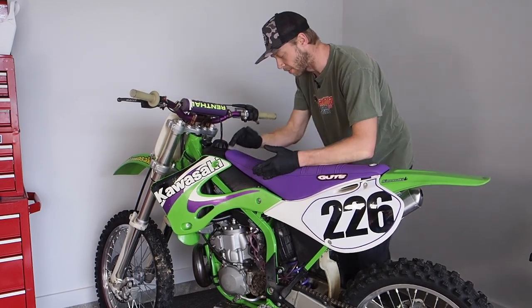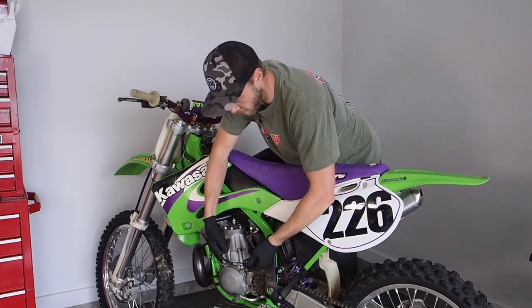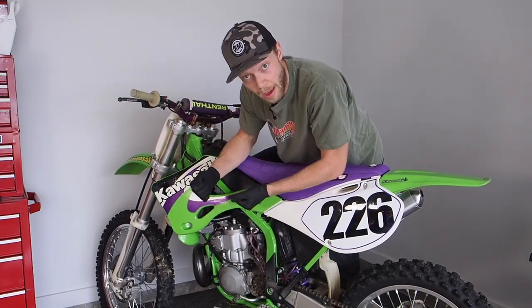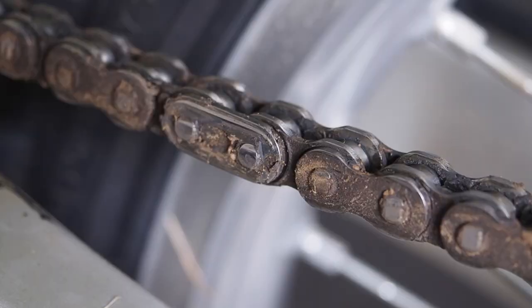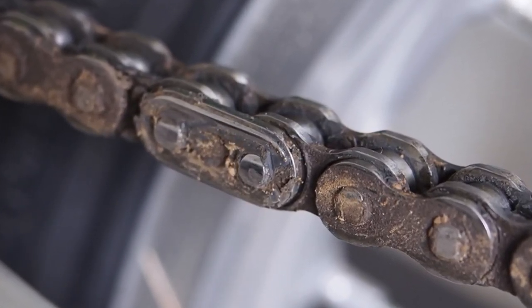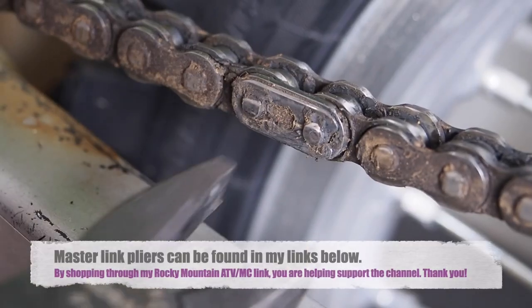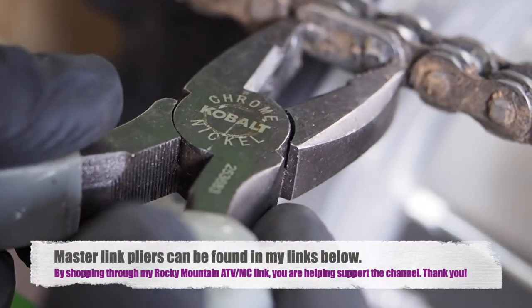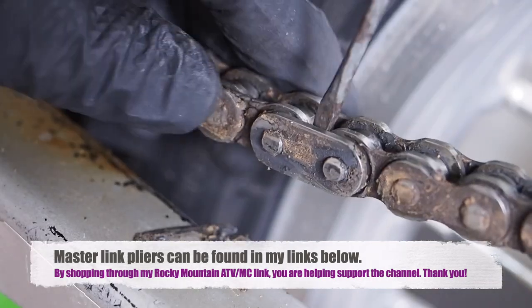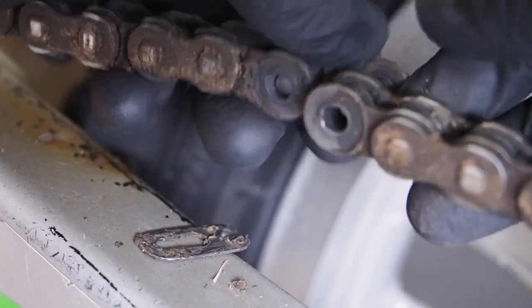If you're wondering how to do that with only one person — come to the other side of the bike, put your foot on the rear brake, then lean over with either an impact gun or a big socket and knock that bolt or nut free. That's a quick method on how to get that done without two people. Now that the front sprocket bolt is off, you can go ahead and pop the master link off with a set of pliers. They do make special master clip pliers, but it can be done with normal pliers with one end on the pin and the other end on the clip.